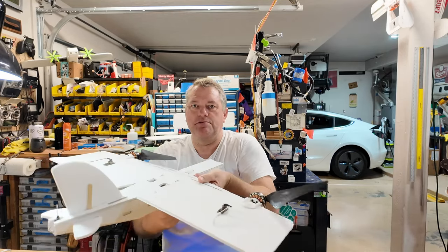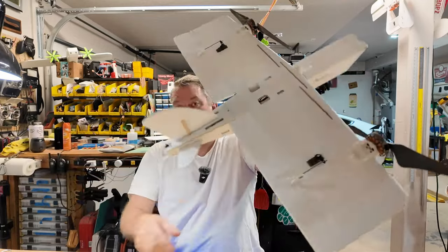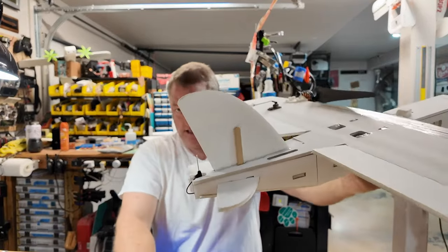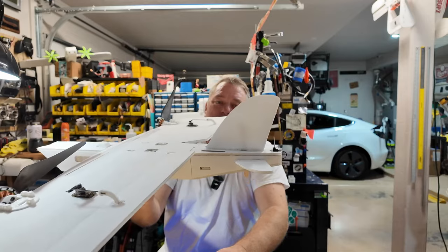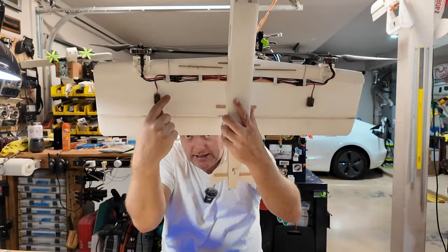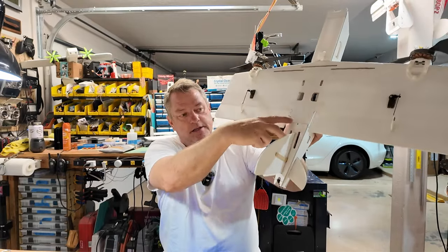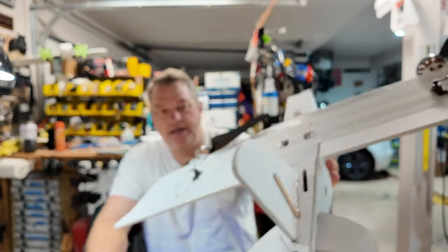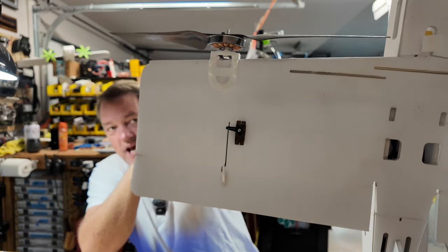But instead, I came up with this beast — V3. By this time I was done with that project. V3 is nothing more than my FPV plank, still configured basically as a single — that's where the pusher motor mount would go. That instead is the ELRS antenna sticking up behind the vertical stab. The ESCs live back here; you can see the wiring following the leading edge of the wing coming into the fuselage. The ELRS radio is all the way aft, and the servos live literally mid-span of the wing, just after the motors.